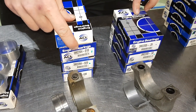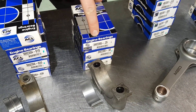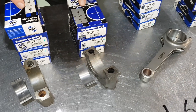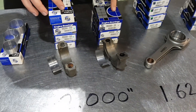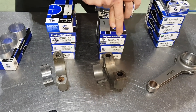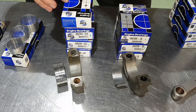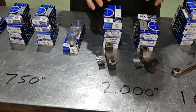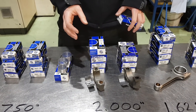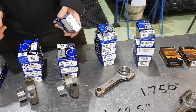A series you've got 3M2204 and on the A plus 3M2205. The difference on the 1275 main bearings in particular - they run a metric size oversize. If your crankshaft's worn out at all and you've had it reground, you'll need a bigger bearing to suit. We keep down to plus 40. We don't list them on the website, so if you need plus 40 and your crank's that worn out, we do have some stock.